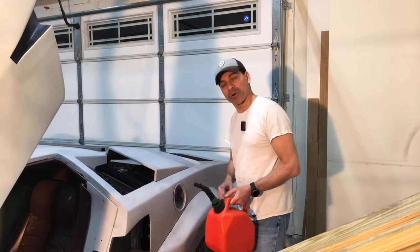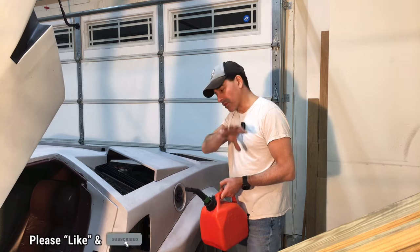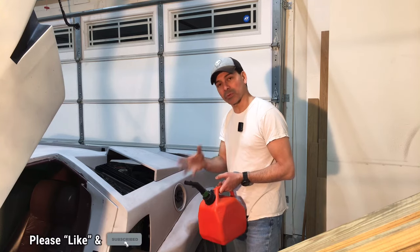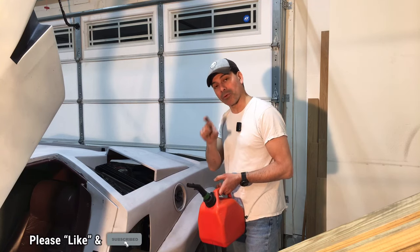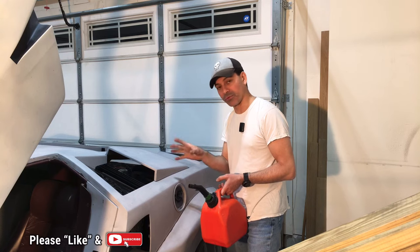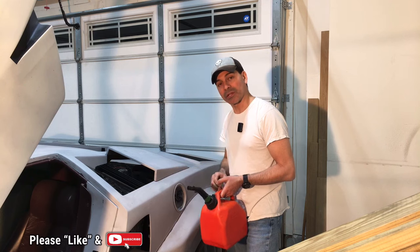All right, well, that pretty much wraps up this video. As we see here, that solved the problem, getting rid of all that old junk. It obviously had cracks and breakdowns in it where the gas was leaking through. Now we went ahead and we used, and keep in mind, it has to be proper fuel filler hose because it needs to be rated for fuel. Can't use radiator hose, things like that. You got to use the right stuff. But as we saw here, that solved the problem.